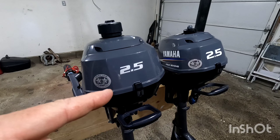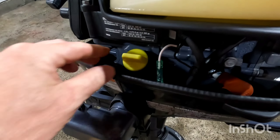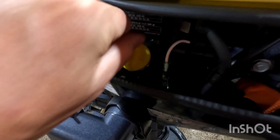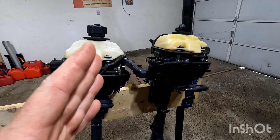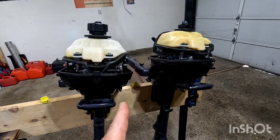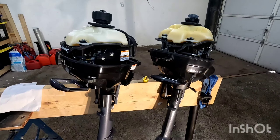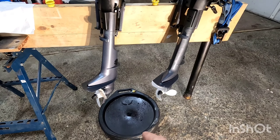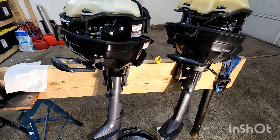So we're going to pop off the covers. You can take off your oil fill cap. As you can see I have the motors tilted slightly — when the oil is draining it's going to drain more straight down instead of on part of the engine casing. On the same side as your shifter, right up in here, that's where you drain the oil and that's going to be a 10 millimeter. Just make sure you have an oil pan underneath and we're going to use a 10 millimeter socket to take the drain bolt out.